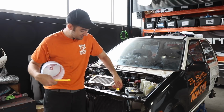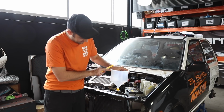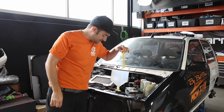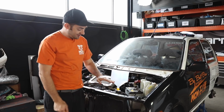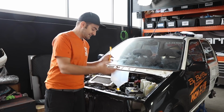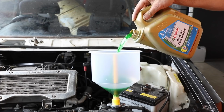And the idea is that you use this little adapter, which you put on the radiator, and then this thing goes into the top of it, and then you've got a plug. And the idea is that you can fill that up. It means you're not going to spill stuff everywhere. And then when you're done, you can jam that in, which blocks it, and pull it off. It also has the added benefit of adding a whole lot of extra head and pressure, so that when you're trying to bleed air out of it, it just works better. It's way less spill-prone. So this, total winner.